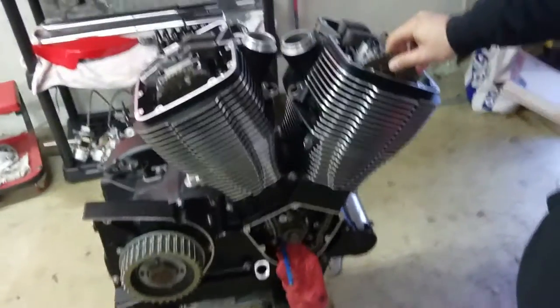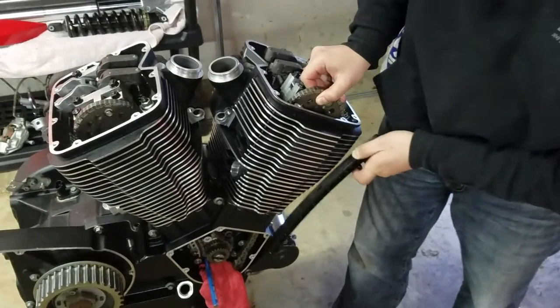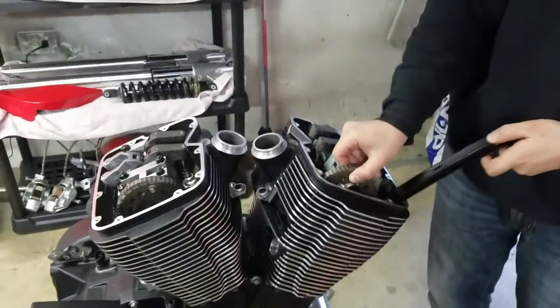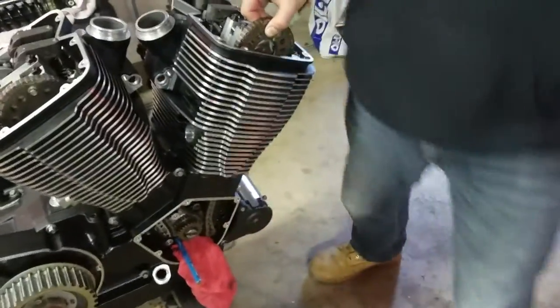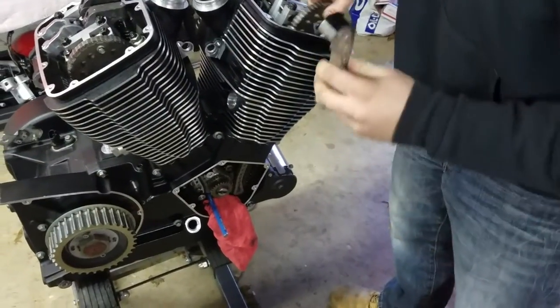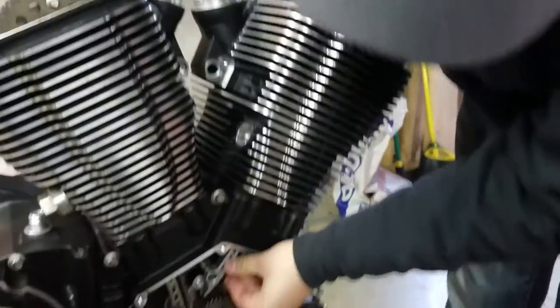The next part is you have the guide. This black one — it's plastic — it's going to go in the front side of here. It's not going to go on the tensioner side, so you can just go ahead and slide that guy in there as best you can. You can get it kind of close; it doesn't have to be perfect. Then this one is the cam side — you can see it's actually aluminum. You just move this forward and slide that guy in.